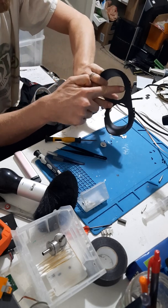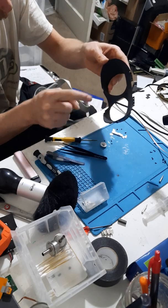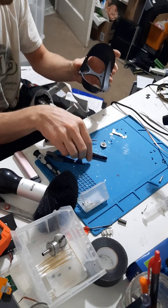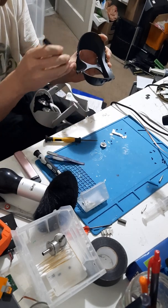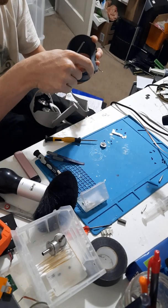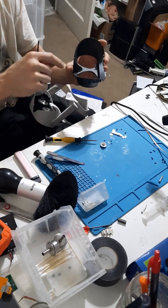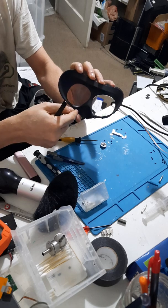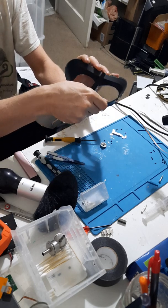There's 2 here, 2 here, then 1 on each side on the bottom. This is a bit trickier to get out. I use the tweezers to kind of wedge in there and go along and pop each little latch off. I started from the bottom here and went that way, and then from the bottom here and went that way, and then the whole thing.